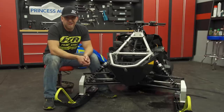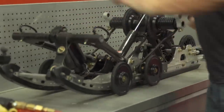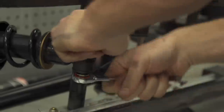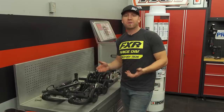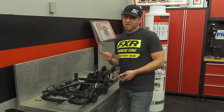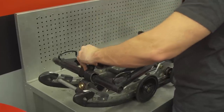The next big update is the rear skid, which requires getting your hands a little dirtier — we've got to pull the entire rear skid right out of the tunnel. Once it's out, we take it nearly completely apart and replace the shocks, springs — both coil and torsion — as well as the limiter strap to allow the rear skid to move further. The stock rear suspension travel on the Evo is a respectable 9.1 inches, but the Evolution update increases that by over 50%. Polaris built the Evo with this kit in mind, meaning you have to change shocks, springs, and limiter straps, but you don't have to touch the rails or the torque arms.